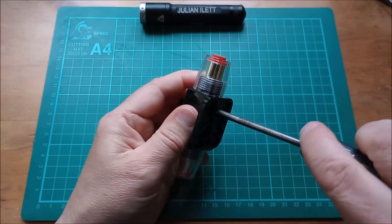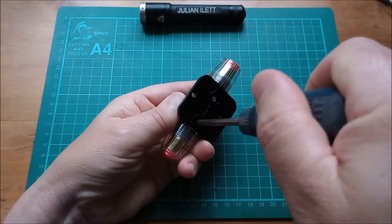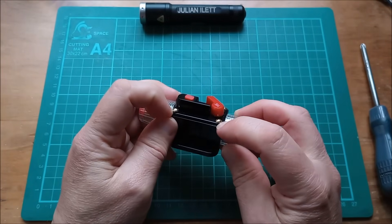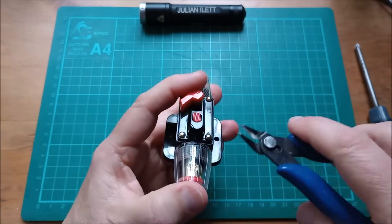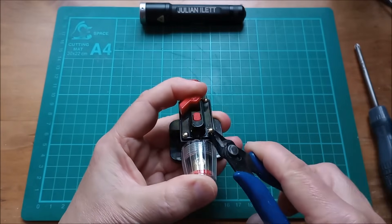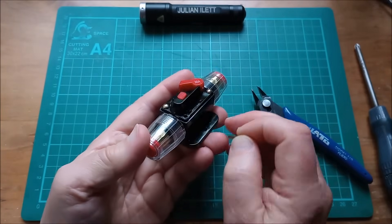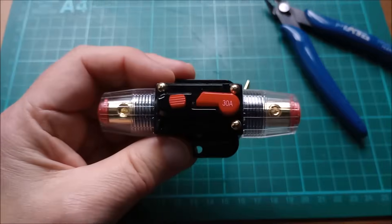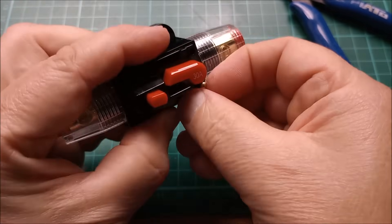Let's take this apart. There are two screws underneath — one undoes and comes out, the other just binds and doesn't want to come undone. There are four what look like rivet tops, but these are just pins. If you can get your cutters underneath them you can simply lever them out. This one is the least pushed down — I can lever that up and it just comes out. It's a straight pin that pushes into the plastic underneath, but that's enough to hold the lid on. I'll do the other three.